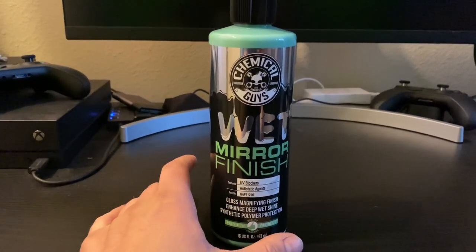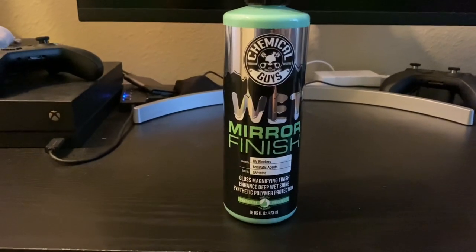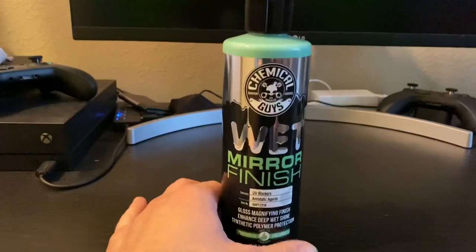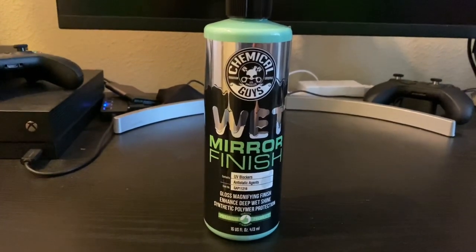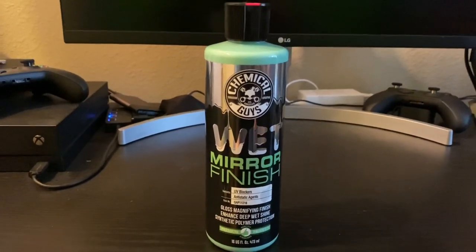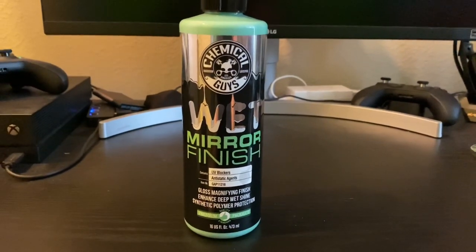But yeah, I'm gonna give it a thumbs up because it was extremely easy to apply and it's a good place to start. It's not complex like a ceramic coating where you have to worry about not getting all the product off and leaving high spots on your paint. And there's not a lot of tricks to this stuff. It was really, really easy to put on, really easy to take off. There was that 15-minute window where you did have to let it sit on the paint, so I wouldn't recommend doing it in direct sunlight because I don't know how that 15-minute cure time is going to be affected by sun and heat. So we did it in the garage or in the shade, or do it in the evening or the morning when the sun's not up yet, beating directly down on it. So you don't need a garage to use it. You can even pull into a car wash bay after you wash it and dry it and put this stuff on there, as long as people aren't honking behind you to get through.